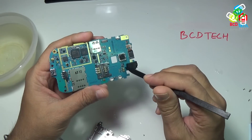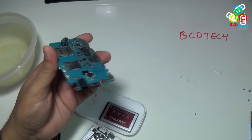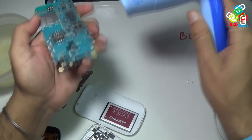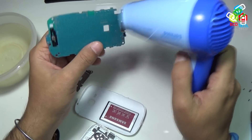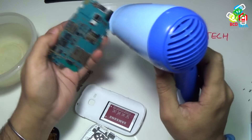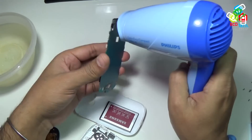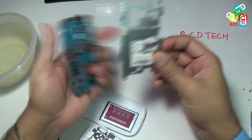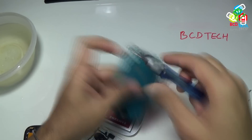As you can see there is a water drop on the board, so go again — but before that, put the small screws aside so they cannot blow away with the air. This time heat and dry every component on the mainboard. Go with drying this headphone connector. Dry each and every IC on the mainboard, and maintain the temperature such that you can still hold the mainboard in your hand. This will limit excessive heat. Now I think I have dried the whole mainboard. Cool down the board to room temperature, and once cooled down, let's reassemble the phone.